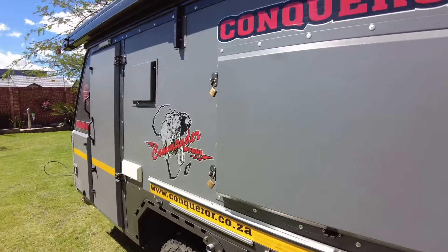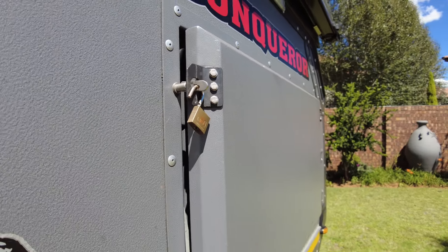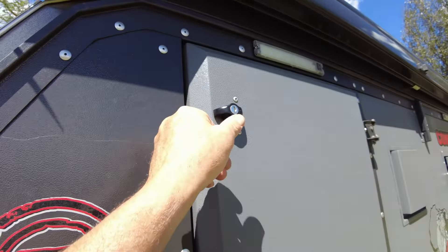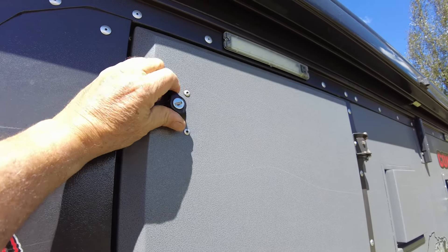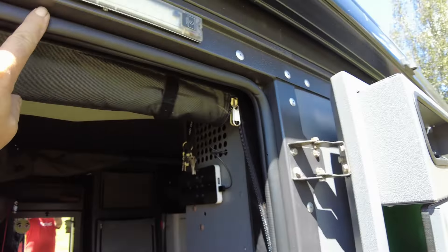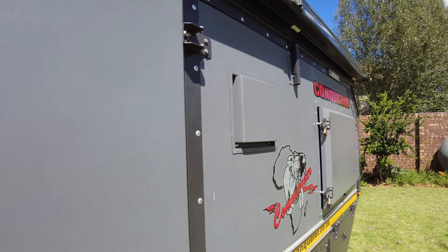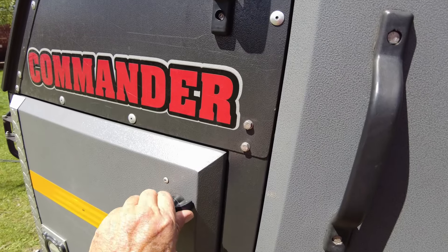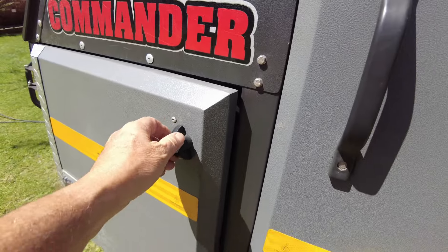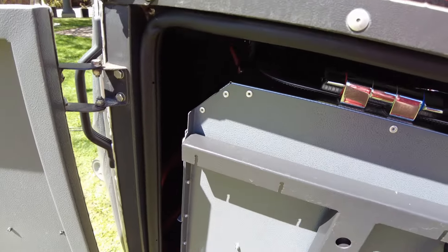Let me show you the way I store my caravan. My caravan is stored in a closed garage. None of these doors is fully pulled in and up against the rubber. Look at this door — I'm going to pull it up against the seal, and that's where I leave it. The reason is to save the rubber. This rubber doesn't help your caravan if it's parked for years and years inside storage and the rubbers don't seal anymore. Remember, we're using it for off-road. Look at my rubbers — perfectly, perfectly sealed. I also use silicone spray on the rubbers from time to time.